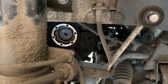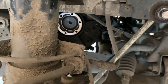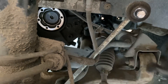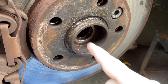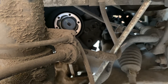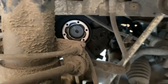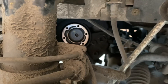The driveshaft's been removed from this side — it was held on by six bolts. You do need a star key to get those off; I think they're 12 or 13 star. Got those out, pulled the shaft out, and then there's a nut that holds it on — take that nut off and it just drops through. Did exactly the same on the other side, but the driveshaft is obviously slightly bigger. There are two little nuts that hold that driveshaft on above; once I got those out it popped off because that one just slides on with an extension on it.